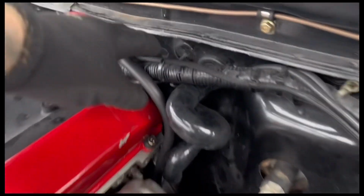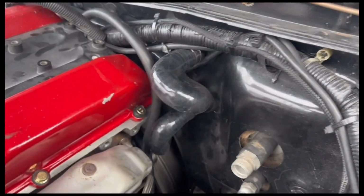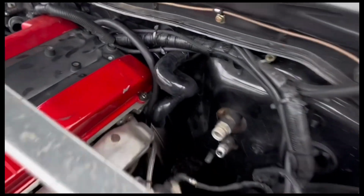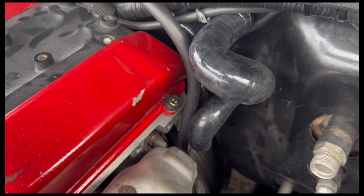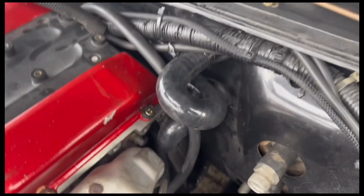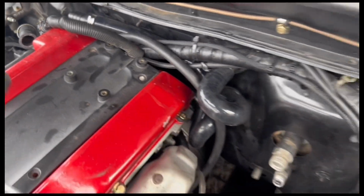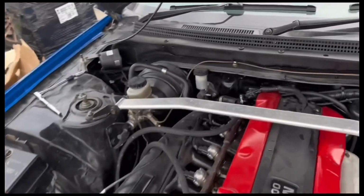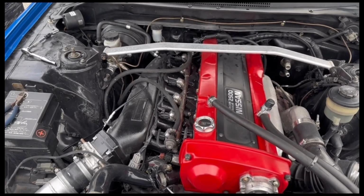I've got some Jubilees marked down the road. Had some new pipes. Obviously, but this one, the original hose, had this heat proofing on it, which was quite handy because this is quite close to the manifold, so I'm gonna have to get some heat wrap for that or something. Same as this coolant hose here, which goes quite close. We need to sort all that out, but we still need to relocate this oil feed, which is supposed to go around the front of the turbo, like I said before, when I put the car back together, but we haven't done that yet. We're on coolant hoses today. Just need to connect up the front on the intake side, and we should put some coolant in it, and everything should be gravy.